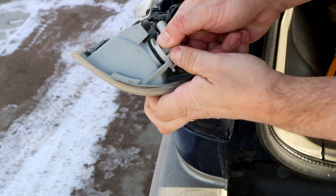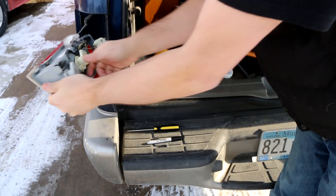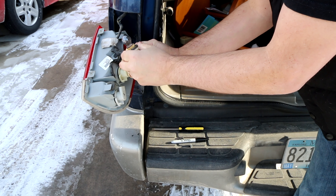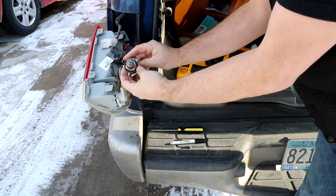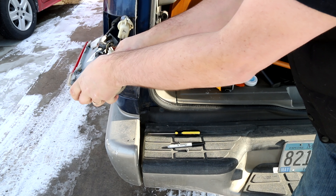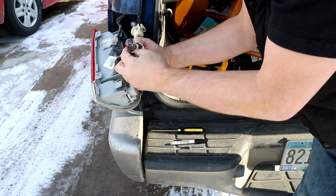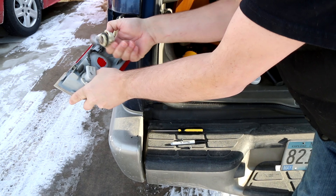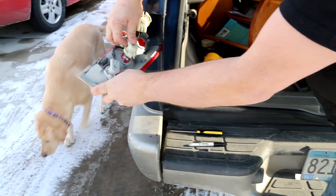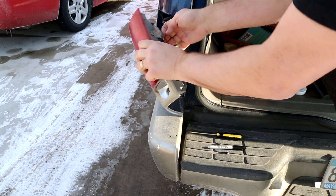See this tab? Push it in — it's kind of like a safety lock on a pill bottle. These take a slight twist, it's like a puzzle. Another thing to check is that the accident could have burned out these light bulbs or broken the light harness. This one is not broken. You see how they clip in there? They just go in and twist, they go in and lock in place. And then you're going to have to remove this tab that holds the wiring harness in place.